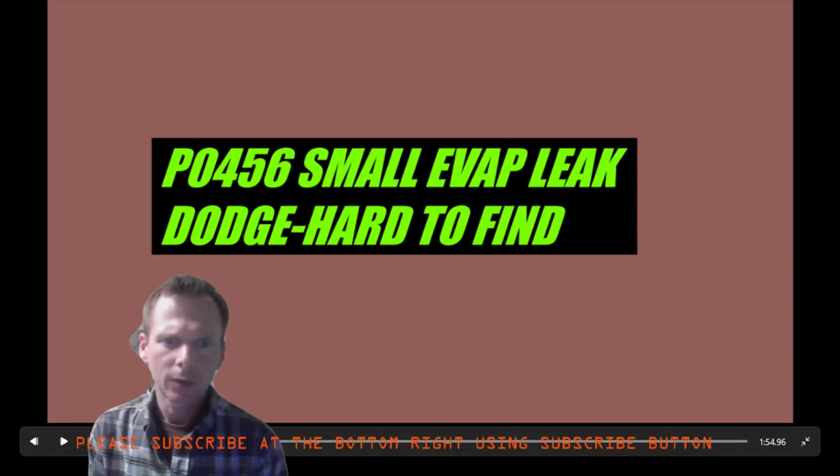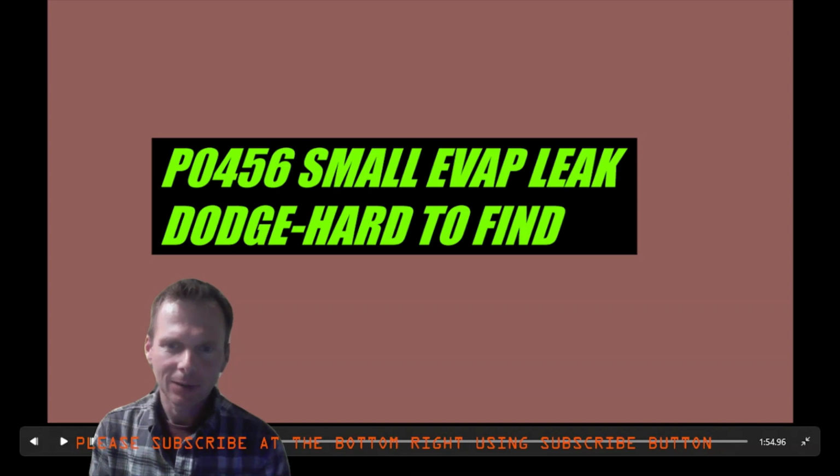Okay, so in this video, I'm going to look at a small evap leak. It was on a 2013 Dodge Avenger, and it's a good one. Basically, it's the first year with the fuel tank pressure sensor on this vehicle line, and I did the test, and it failed half the time. That's the PCM small leak verification test.